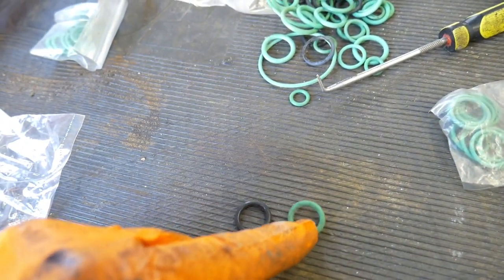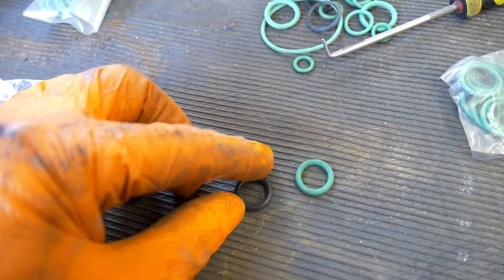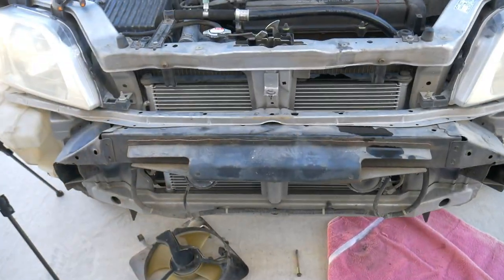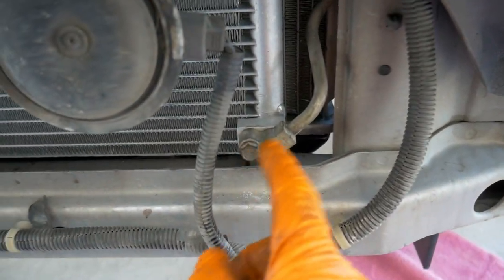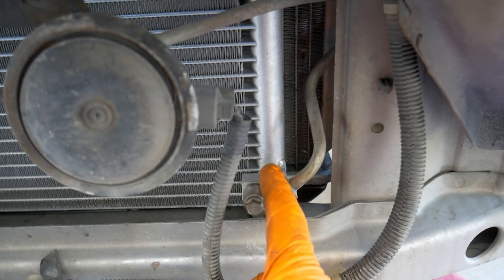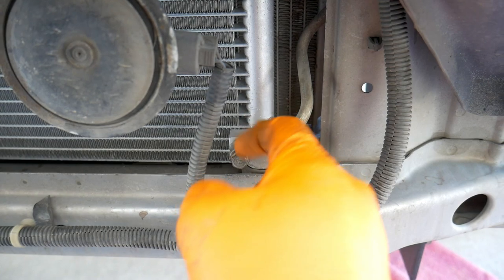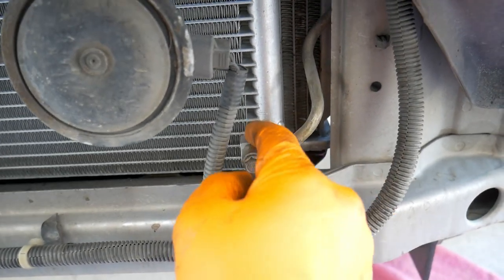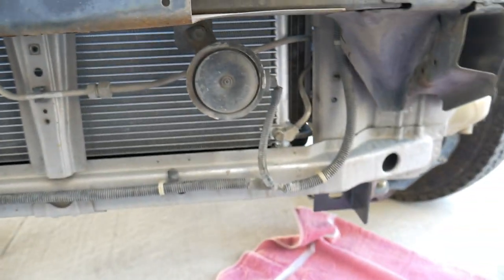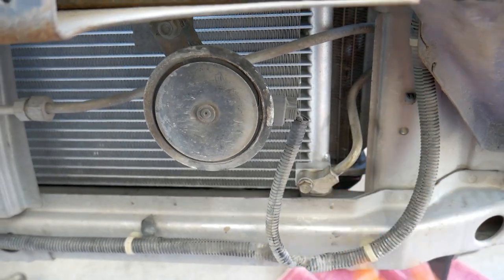Use some of that oil from the cup, or if you have new oil, just lube the O-rings up a little bit, then put them on and tighten the fittings up. The new condenser is in. One tip: when you're tightening bolts up against an aluminum component, do not overdo it because you risk damaging the threading. Of course you want to do them nice and snug, but try not to overtighten — otherwise you'll need to replace that component, and it's almost impossible to re-thread aluminum.